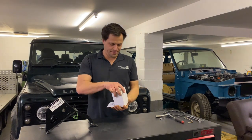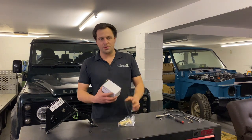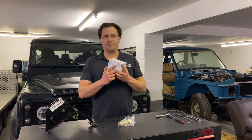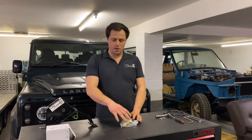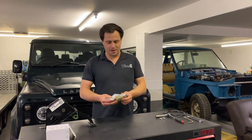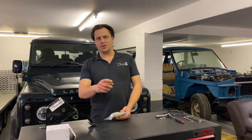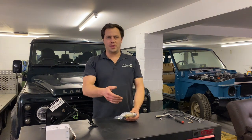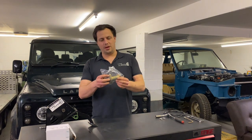Let's get it out of the box. You'll notice on the box it says bed the clutch in for 3,000 miles before fitting. So if you're fitting this with a brand new clutch, you're advised to bed the clutch in first before you actually install the slave cylinder. The reason for that is because the Power Slave lowers the biting point ever so slightly, and with a brand new clutch the biting point can just be a bit too low, so you're better off waiting and installing this after the clutch is bedded in.